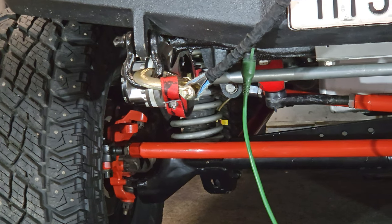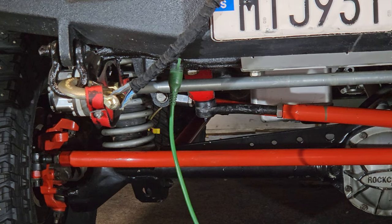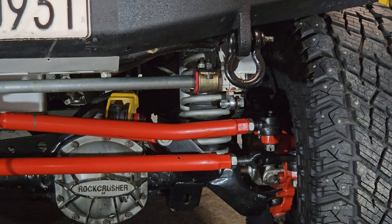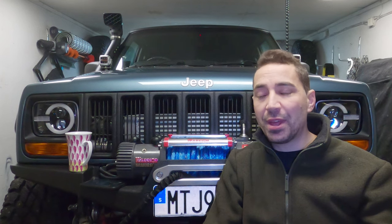If you're getting into the point where you're going to be buying suspension, you might want to hold off on just swapping out individual bushings on control arms - uppers and lowers - because usually a suspension kit comes with a leaf pack, coils, sway bar links, a panhard rod, a bracket tree if it's a good kit, upper and lower adjustable control arms, maybe a long arm kit. Personally, if you're going four and a half inches or above, just go long arms straight away and don't bother with anything else.